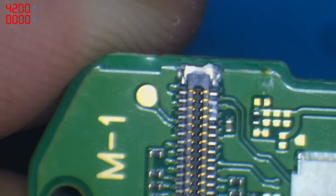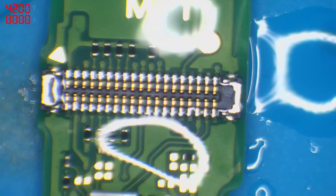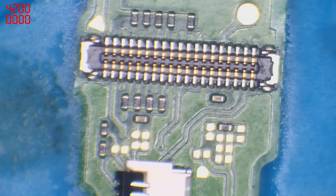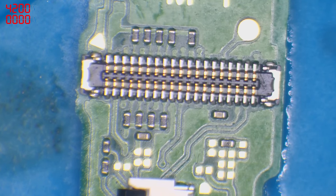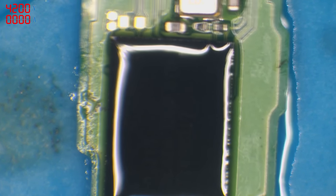Directly on the other side we've got some damage to the game card reader and touch screen connector as well, but I think just cleaning this bit up should be fine. I'm going to pop a bit of isopropyl alcohol there and give it a scrub with a toothbrush. I did just speak to Jason from Jason's Electronics Repair — he said he has come across this once before and determined it as an anti-piracy chip issue. He couldn't fix that one, unfortunately.